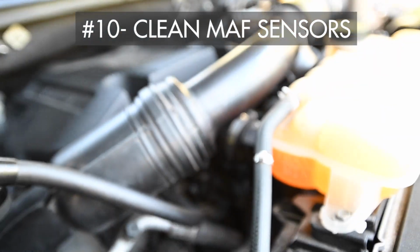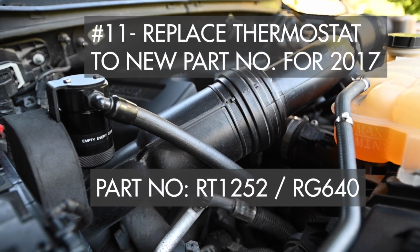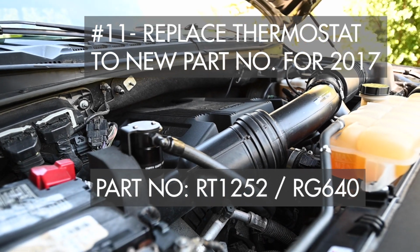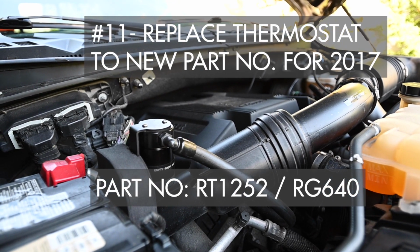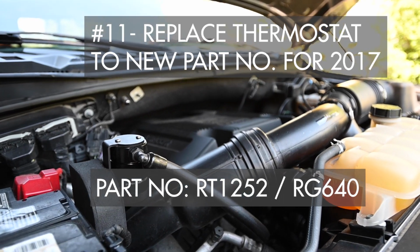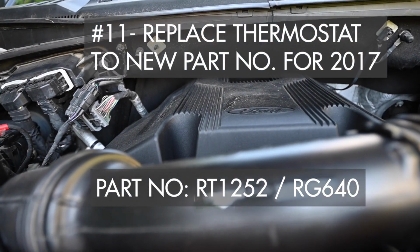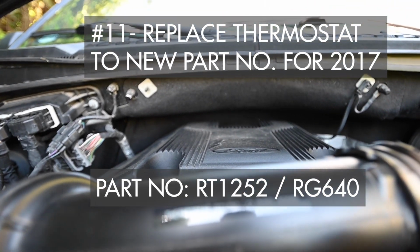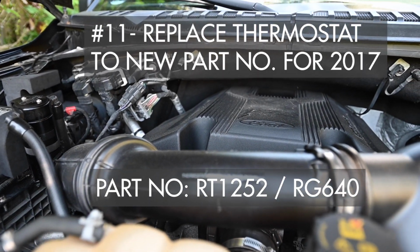The other thing you can do is take out your thermostat and switch it for the current one. Especially on 2017s, they don't tell you that they've updated the thermostat. So it's a different part number now when you go to do a thermostat in your 2017. And it runs cooler, so it doesn't overheat on the hills. So that's a really good thing to do. Here's the part number right here. I don't know if you can see that, but if not, I'll put it on the screen.